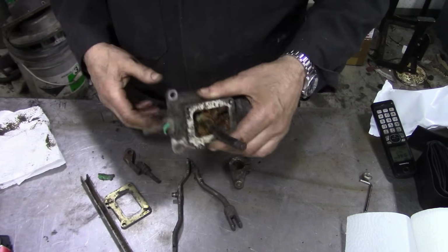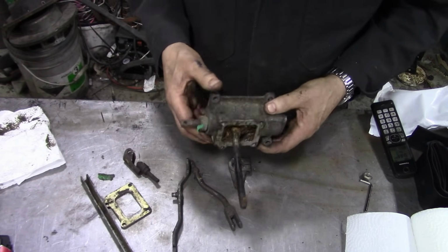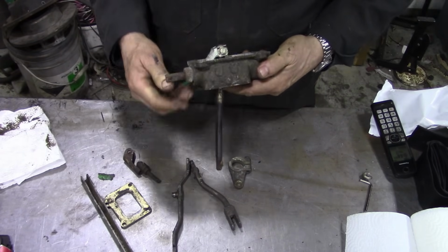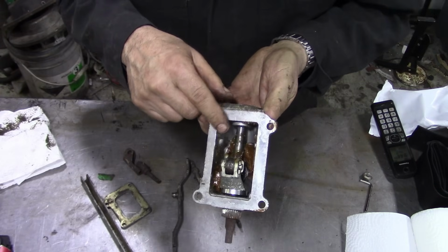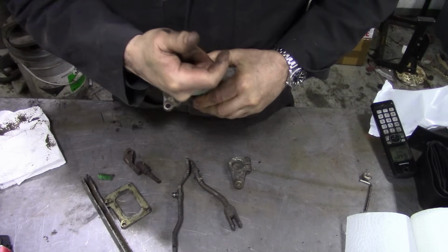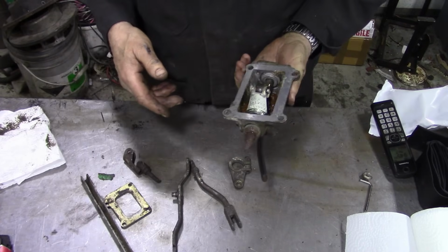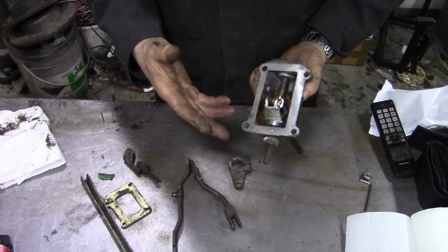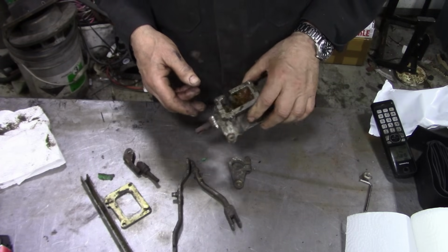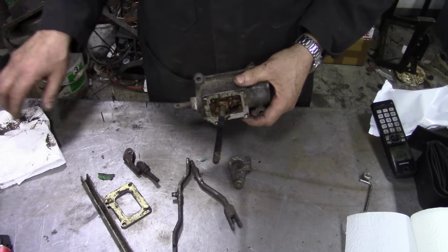Now, when you're doing things like this and shot blasting or bead blasting or whatever you're going to do, it's advisable not to do anything with grease in the sandblaster. You'll just contaminate your cabinet. So we've got to clean that out. And also, this is seized up. Kind of common, isn't it? Never get used. So we're going to take all these screws out, take it all to bits, the best we can, and see if we can salvage this. I think it'd make a nice little unit.